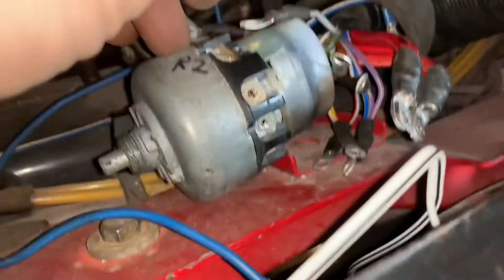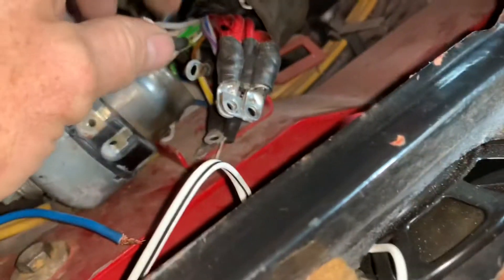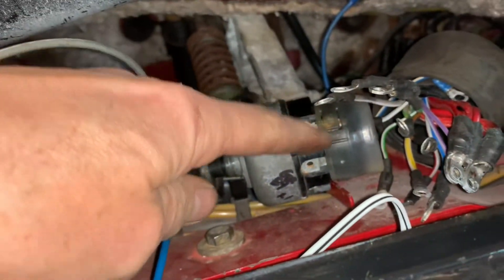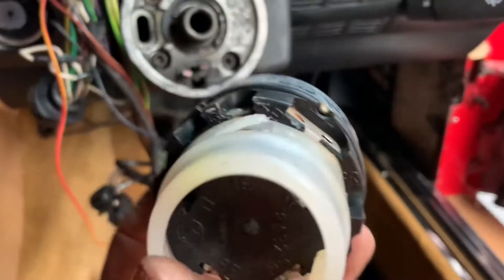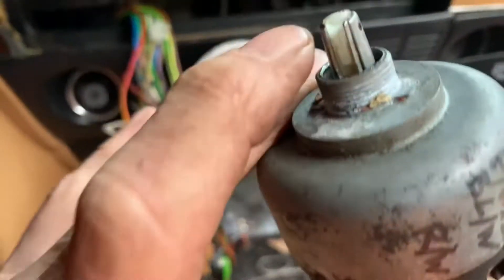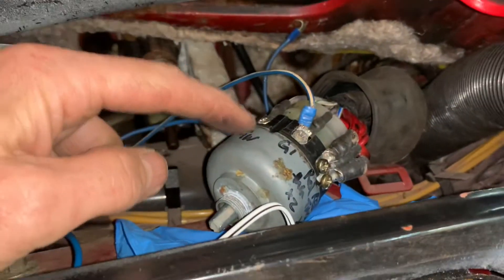The second inside wire - the brown wire - and then the yellow, green and white wire should be the rear fog light. We're going to take this switch off, removing all the outside wires and marking them. This is the switch out of our parts car. It looks exactly the same as the one we've just taken out, but the bit at the top isn't broken and the bit where you push the light bulb in is still intact. Let's see if hooking this switch up makes our fog lights miraculously work.